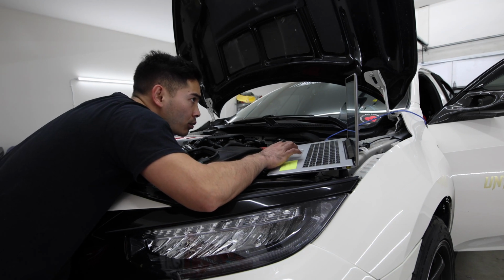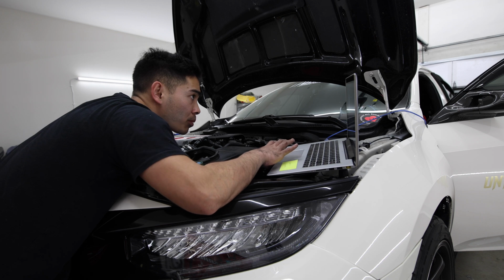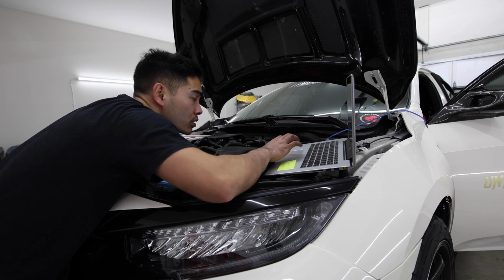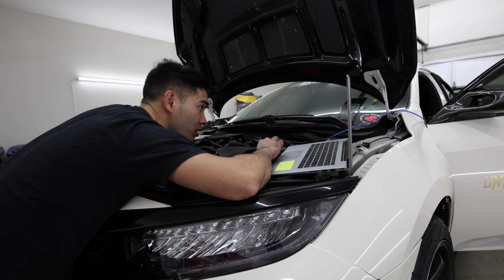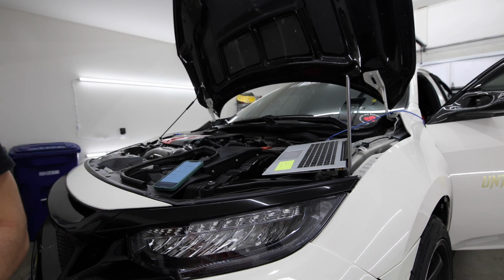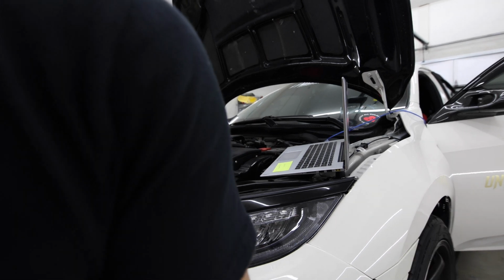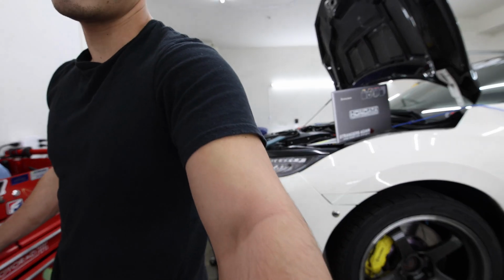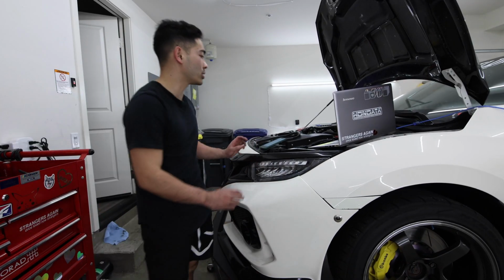I want to do this to make sure it's operating properly, but let me pull up the codes. My wastegate is in calibration, surprisingly. Nice. Perfect. It's actually calibrated already. I just looked at it right now. It's within specifications. I believe you can go from 0.002 to 0.0, and it's at 0.0 exactly right now, which is nice.